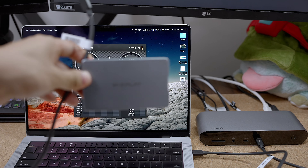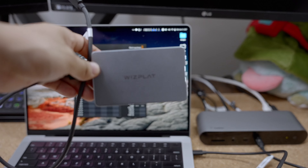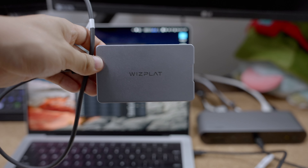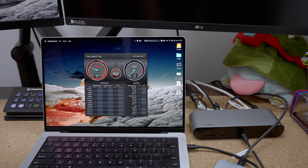You are unlikely to experience slowdowns because this dock does not have enough bandwidth. Here I'm doing some testing to figure out if connecting monitors affects the speeds on devices connected to the dock. For this testing I'm using a Thunderbolt 4 SSD drive, and on the Blackmagic Disk Speed Test I was getting 1900 megabytes per second for write and 2600 for read speed.